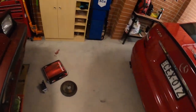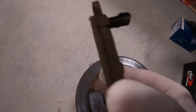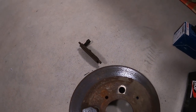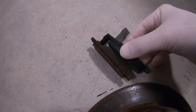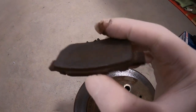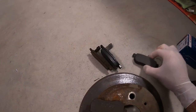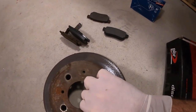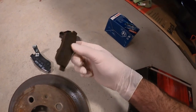Time to put some rotors. Let me show you what we got versus what we bought. This is the original one that came with the car — check the brake. You still got some in it. But this is the new one — see how thick? That's the difference. Lining up next to each other, you can clearly tell the difference. And this is the other one — if you look at it carefully, you'll notice it's actually not straight, which means alignment issues. Brand new one — and we went with the Bosch. This is the rotor that we have. Don't worry about the rust — rust is not the issue. Put your finger over here and you can see and feel the groove. There's a groove from the brake being like that — as you keep pressing the brakes, this area gets eaten. And that's why you have a groove. Because this is way too rusty and fugly, hence we decided to go with the new one.